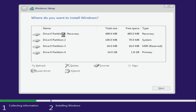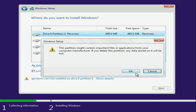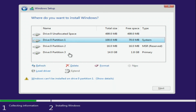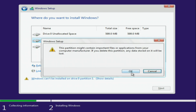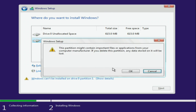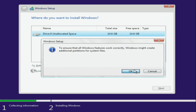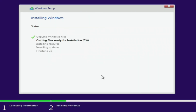After a while we get this window showing all the partitions on the eMMC. I will remove them all and create a new one — I've already got Windows 10 installed, which is why there are multiple partitions. Now just click Next and the Windows setup will start.